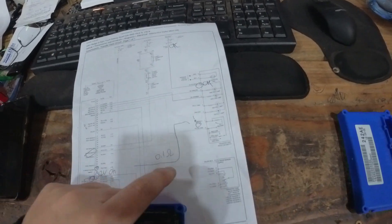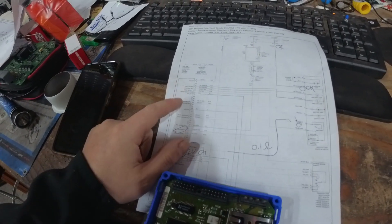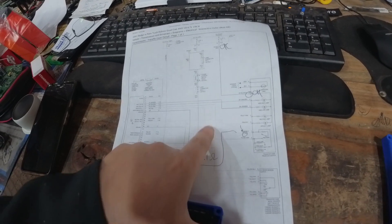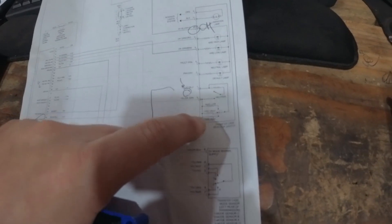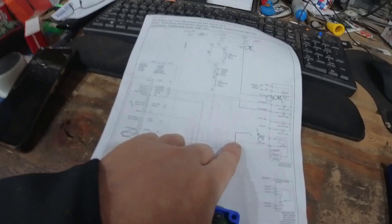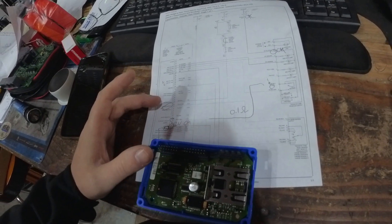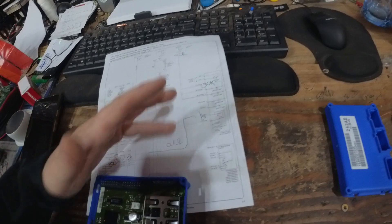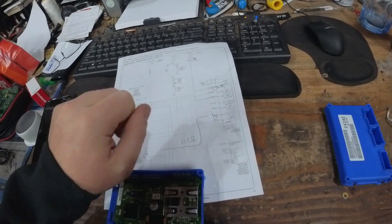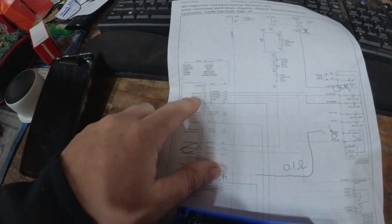So what we've got here: a sensor ground, a ground, mode select, high indicator, low indicator, neutral, default indicator, ground, mode sense. This is the mode select ground. Then we have our voltage divider — each one of these is a resistor that has a different value, which allows the signal to return through the switch. Basically it's changing the voltage from 5 volts to ground. The variable resistors change the voltage, and that's how the module knows what selection you've picked. Once it's picked that selection and got verification from the lights, it'll send a ground to enable whichever light.